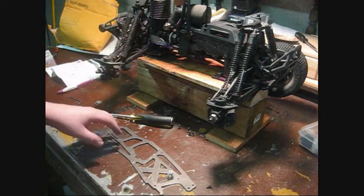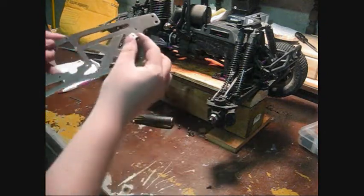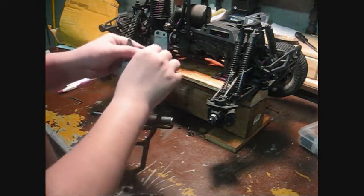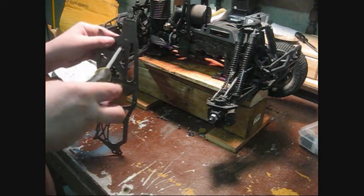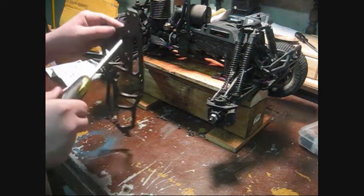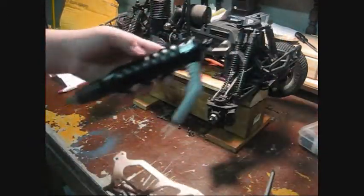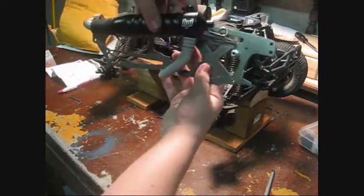I'm done with the unboxing. I've got my side plate off here on my chassis, and I'm just installing this mount for the tune pipe. I thought I'd make a little video. I could have just capped the chassis on there and put the screw in, but then you wouldn't get the tightness and security. I'm probably gonna blue loctite this, but not doing it now. Got my exhaust plugged on there, and it'll just sit there right like that, going to the back of your engine.